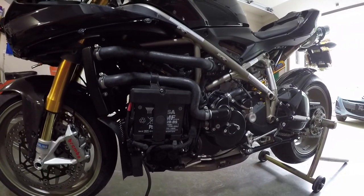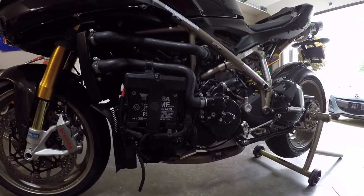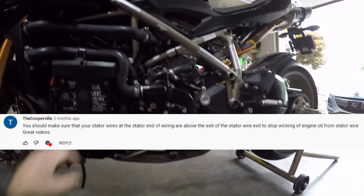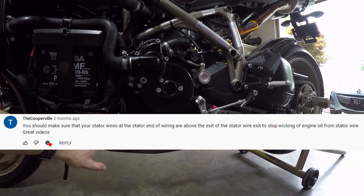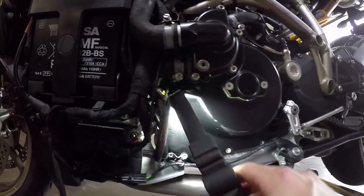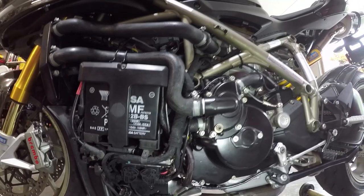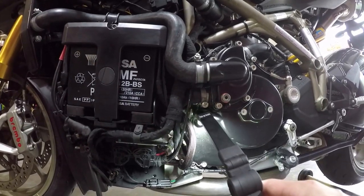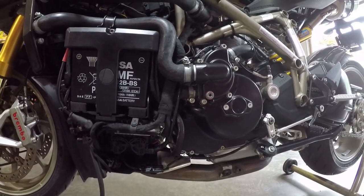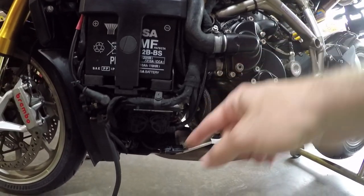The stator wire rerouting all stemmed from a comment left on the voltage regulator replacement video that I made. The commenter said: make sure you move the connector where those stator wires connect to be above where the stator wires come out of the engine casing. So if we look right there, you can see them right here. The reason is that oil will actually wick down the inside of the wires — meaning inside the sheath of the wiring — kind of like a candle wick, and it'll travel through the copper wires and trickle down to the lowest point.